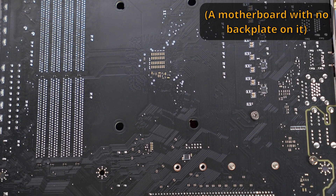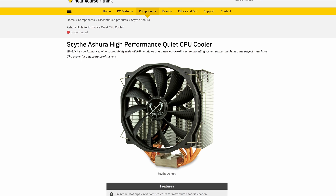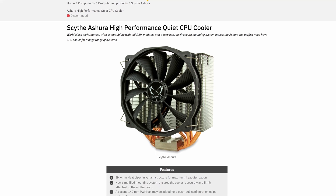That's why many people start off building by putting their motherboard on a table, because that keeps the backplate in place. Obviously if it's already installed in your case you can't do that, but it is worth knowing. The other thing to know is that sometimes with some coolers, you do actually need to change the backplate — you can't keep the stock one. And in that case, it depends entirely on your case.